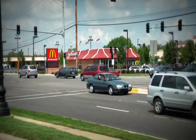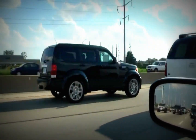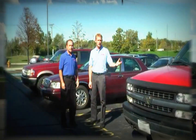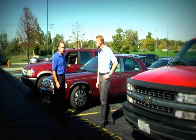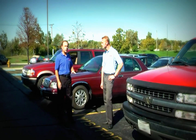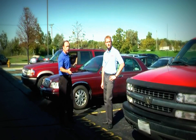And some of us simply want more ride control performance than came on the vehicle originally. KYB has a solution for all of these demanding conditions, driving needs, and preferences. This vehicle came from the factory equipped with a monotube design shock absorber. Now if the owner wants to restore the handling and control to what the vehicle had originally, the KYB Gas Adjust is the right product. These vehicles came from the factory with a twin tube design shock absorber. The Gas Adjust is a great choice when you want to upgrade the performance of the suspension over the vehicle's original design.